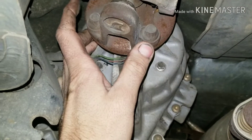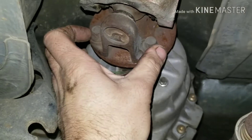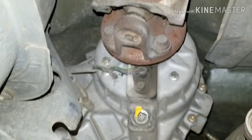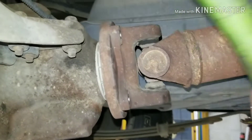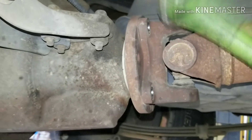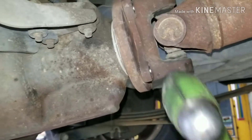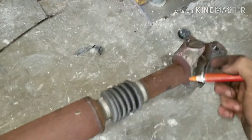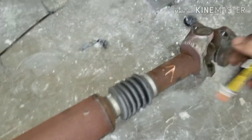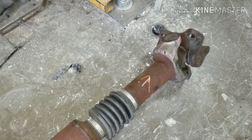You want to leave a couple bolts left in the rear end and go after these bolts here to loosen them. On other models like Ford Rangers, you don't have to do this — it just has a spline that goes in — but on these you have to take the bolts out. Once you get your bolts out of the driveline, you might have to tap it a little bit. You can see how it loosens up; it's usually rusted on there pretty good. Once it's loose, get a screwdriver in that gap and it'll pop right out. I always put an arrow on it so I don't get mixed up, because putting the front on the back doesn't work out well in the end.